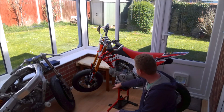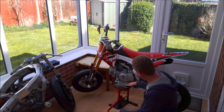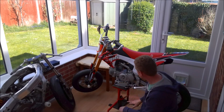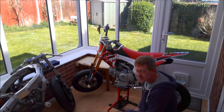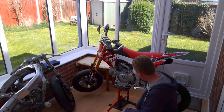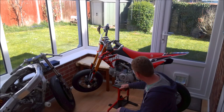Moving back, we have the catch tray. On a normal pit bike the footrests bolt to the underside of the engine, so you can just bolt the catch tray straight underneath. This particular bike has a cross member and the engine fits to that on spacers, so I had to remove the spacers, fit the catch tray in, and make up another spacer to compensate. Even the little crash bungs on the footrests were a pain — the footrests taper in at the bottom, so I had to clearance some of the casting with a file, and then found the uprights you screw into were too high and needed trimming down. Eventually got those on — another couple of hours of figuring it out.